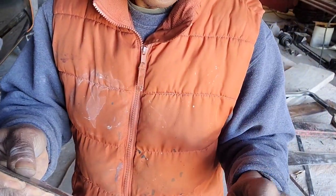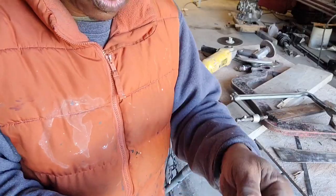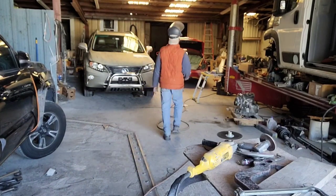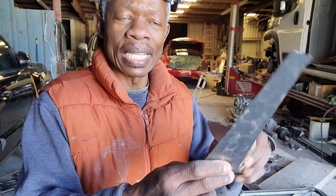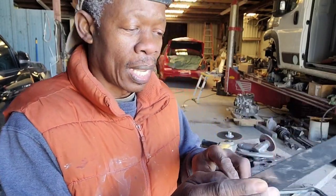This side that I had to cut, this is the side that you're gonna use to clean, when you apply your Bondo. Let me get the putty. When you apply your Bondo, you use this to do your mixing, and you do this to clean the putty knife. The straight side, you never use that to clean and to get rid of Bondo that probably is on this.